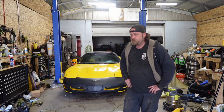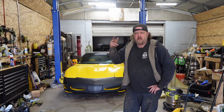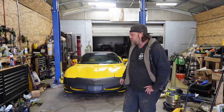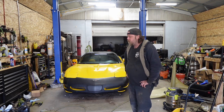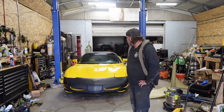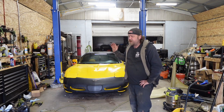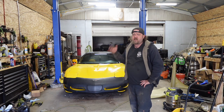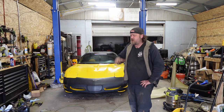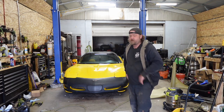Because after about 20 minutes, especially if you had the outside vents running, not the recirc, you definitely knew something was getting warm. But I didn't smell it, so I think we did something. But yeah, fires up, runs good. Like I said, I think it's either gonna be a pan gasket or the rear main seal cover plate gasket. If it doesn't get worse, I'm just gonna leave it, to be honest with you.